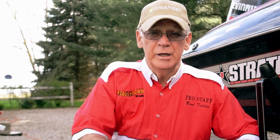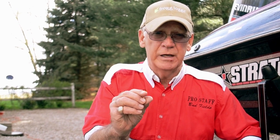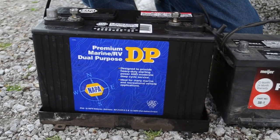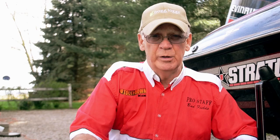By doing it that way, the automobile battery is a lot lighter weight — the way they designed it, they've got thinner plates. When you go talking about a deep cycle battery, a deep cycle battery is designed to offer a lesser amount of power but for longer periods of time. It's got thicker, heavier plates. It will weigh almost twice as much physically when you pick it up because of those plates.